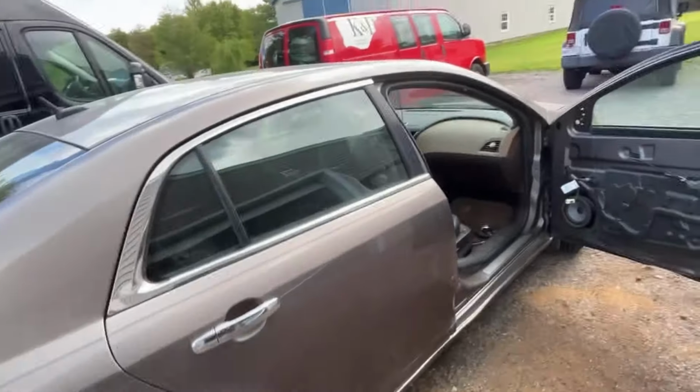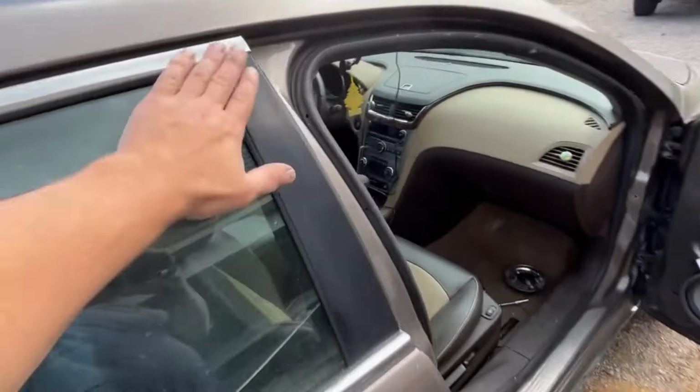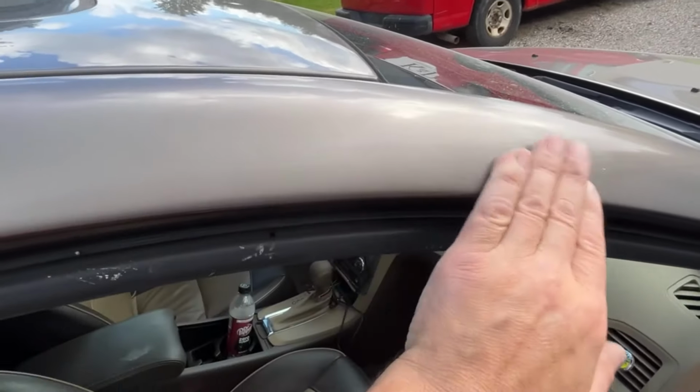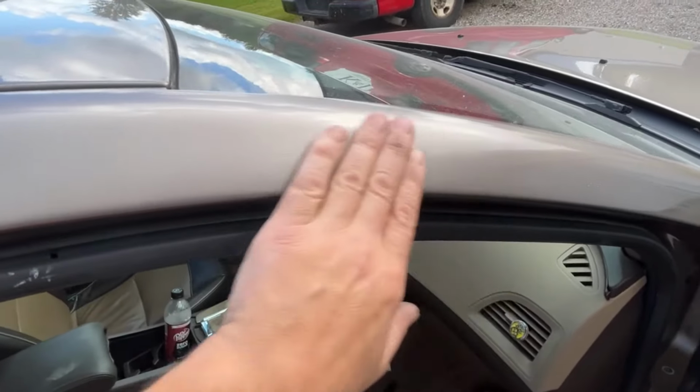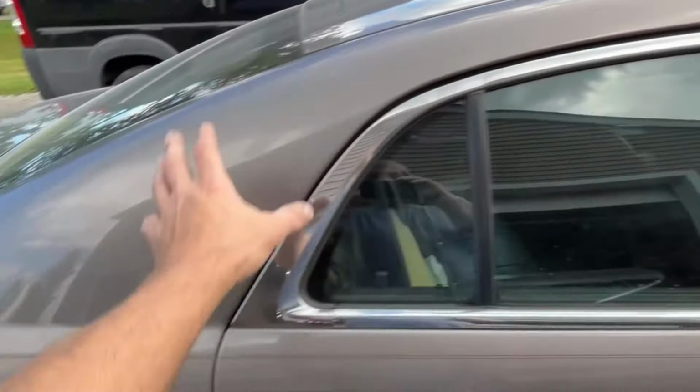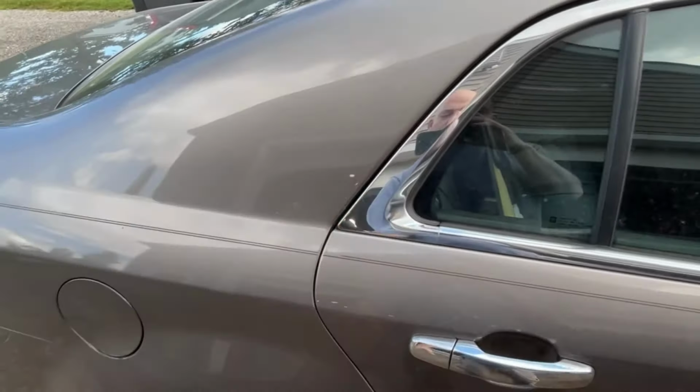I was able to get the duct tape off of the car. I was able to get it off of here and also off of here. It's a little streaky looking from the little bit of residue of glue, which I'll wipe off a little better with some wax and grease remover, and then I could just run the buffer on that and that'll be just fine. What that does is stop me from having to get all up into this quarter panel area.